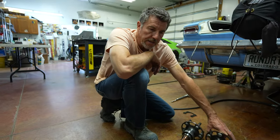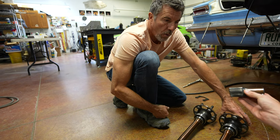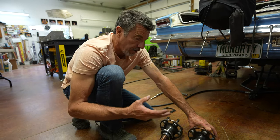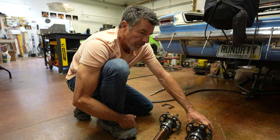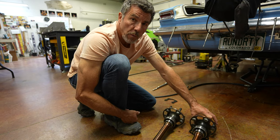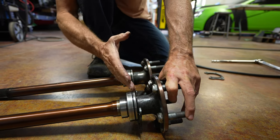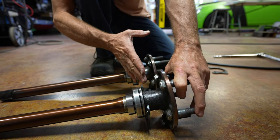Out of the housing — I had to take a sledgehammer and go from the driver's side and knock it back out. It was still kind of wedged in there. Back at the track, everybody's got their opinions on what's happened, what's going to happen — the tire's going to fly off the car — but the brake's still holding it on. That was the only thing holding it on. This could have driven all the way down there. What happens is if you're going to break a wheel and lose it, it has to break on this side of the bearing.